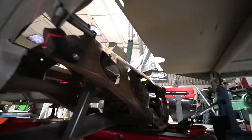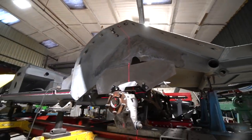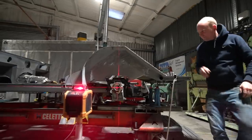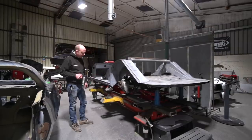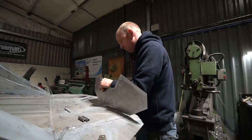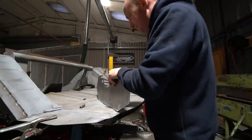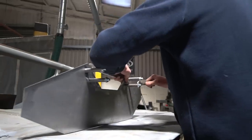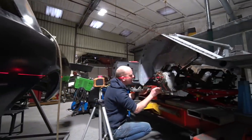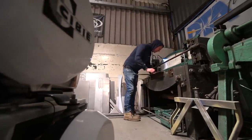Here we have the Jensen, which I've been working on this week. As of the end of today — not fully welded but the rear rail sections that hold the rear independent rear end are now in. The inner structure is fabricated to carry the crush tubes, three inches wide, that carry the bolts which pick up the V-mounts carrying the independent rear suspension frame — all as per Jaguar XJ Series 1, 2, 3. Basically all Jaguar IRS is much the same until the XJ40. The outer end is X308, which is still compatible with a couple of modifications and gives us outboard brakes.